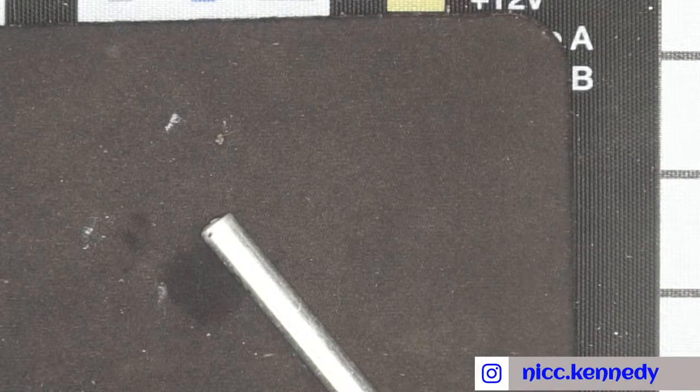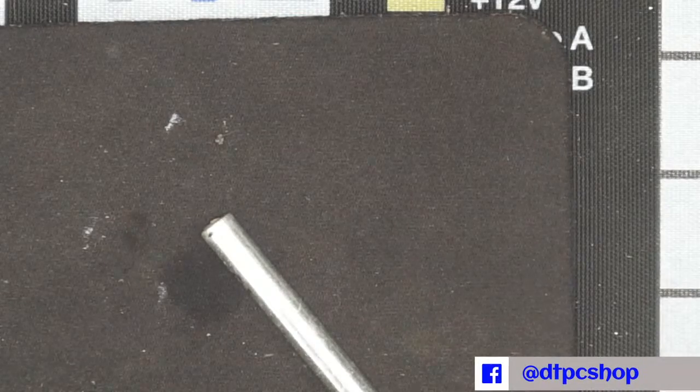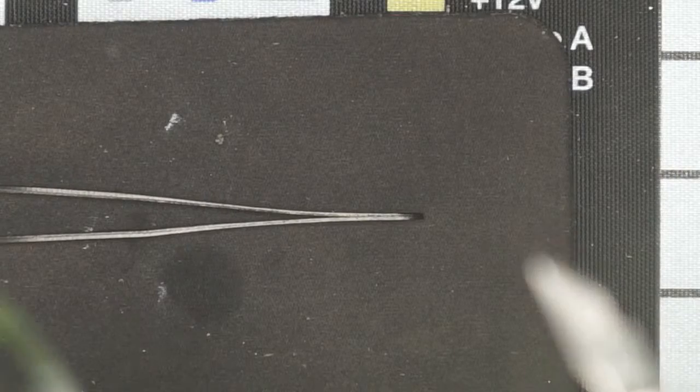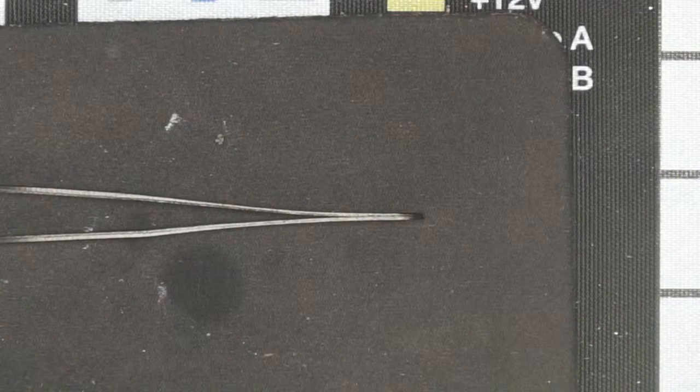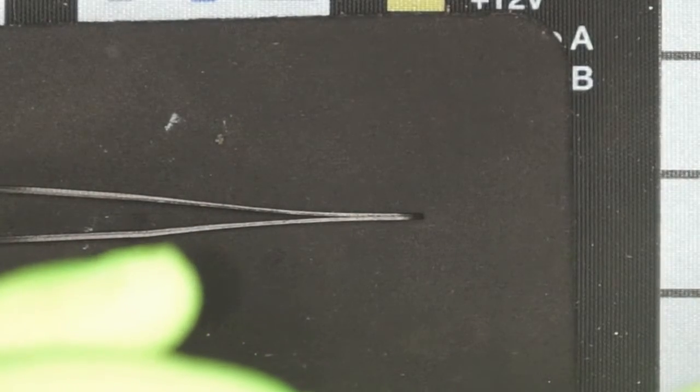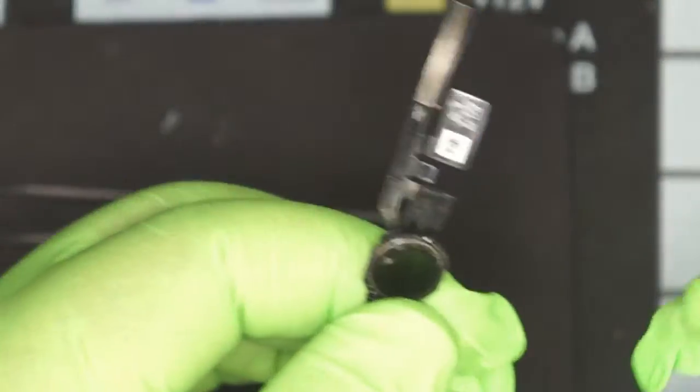And then we'll continue to clean that up. We don't need the panel, just the adhesive. And then we also have this other side. It's going to be tricky because the ribbon cable is attached to it. What do we do about that? Detach the ribbon cable from it. It's just stuck on there. Heat it up and peel it loose. But we're going to risk it. We're going to leave the cable attached to the home button.